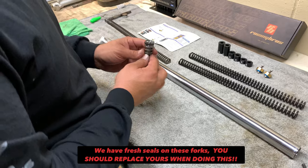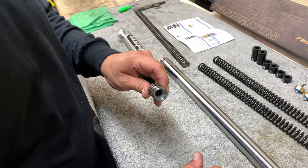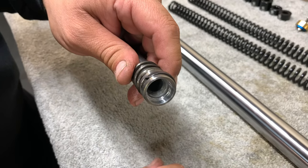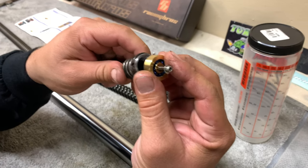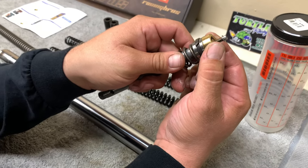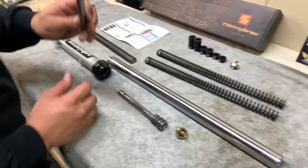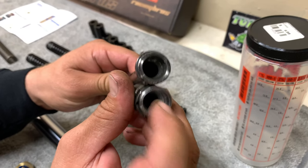The challenge is we already have this one modified — we already took a Dremel bit, or in my case an air tool. You can use a Dremel or any tool that removes metal to slowly go around here and remove it evenly around all the sides. That is so the bottom of this gold emulator valve fits in here. We took a small amount at a time so you can keep this as tight as possible. We're going to show you what a rod that is not modified looks like so you can really see the difference. You can see where we stopped boring — there's a ridge right there.